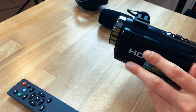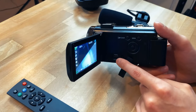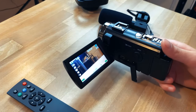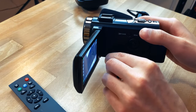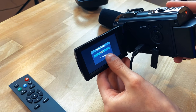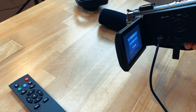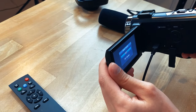One of the features I was very interested in is the mini USB port — you can plug your computer into it and use it as a webcam, and this actually does work and it's pretty easy to do. All you do is select the setting in your camera. If I just take this and plug it into the camera with the other end into a computer, it'll pop up with some settings. You can do MSDC which reads the files off the camera, or PC camera — if you choose PC camera, it will show up as a USB cam. In OBS or something you can use it as a webcam, set it up in the corner of your gaming or whatever you want to do, and it actually works pretty well.